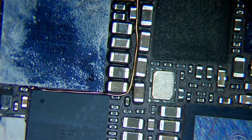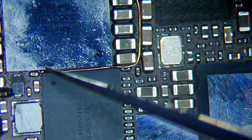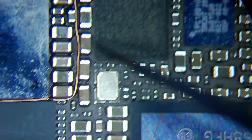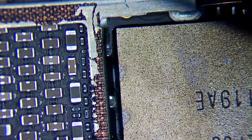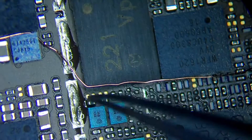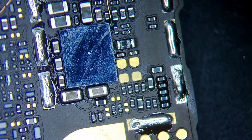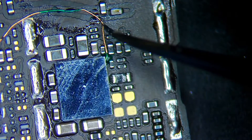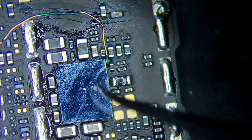As you can see, this is the jumper wire that I've done. Sorry, I didn't take pictures of how it goes under the chip, but there is a pad here, right here, and it goes from underneath the chip all the way here. I tried to hide it as much as I can so it doesn't pop up and cause any short. It goes here, like that, until the audio amplifier chip, which is responsible for the work of the lower speaker — the loudspeaker. And it goes all the way to here; there is a pad here, and I have done this jumper underneath this chip, and it's soldered to this chip.